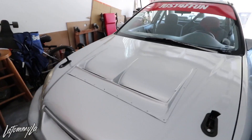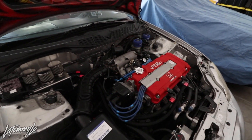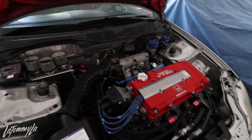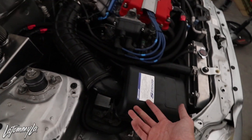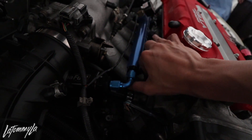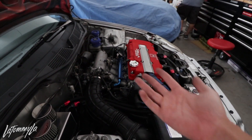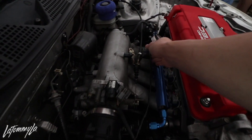Now the main thing is to pull off the intake manifold. I'm gonna push the car out almost all the way and put cardboard or newspaper on the ground, then drain the coolant out of this portion. Once I get it out there, there'll be more light. I'll take off the intake arm — I'll probably leave the air box for now since it's not really in the way. There are about eight to ten bolts; I think five or four underneath. If you have small hands like me you can easily get to it.